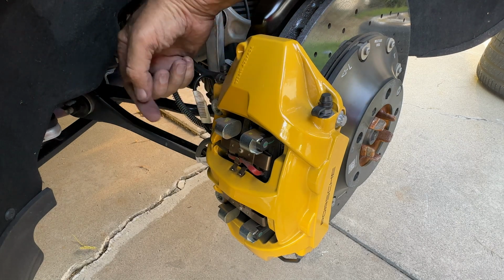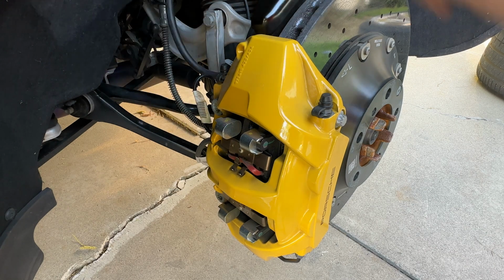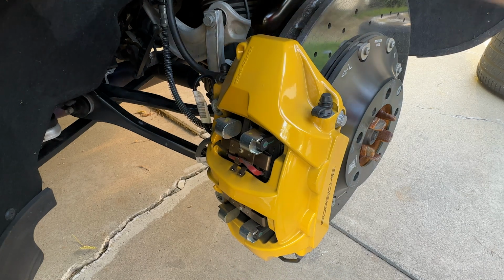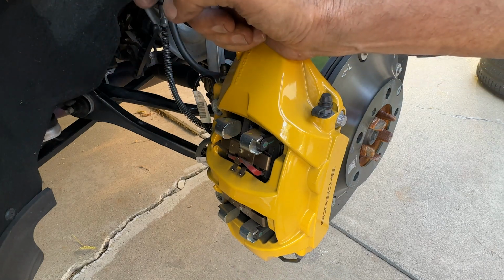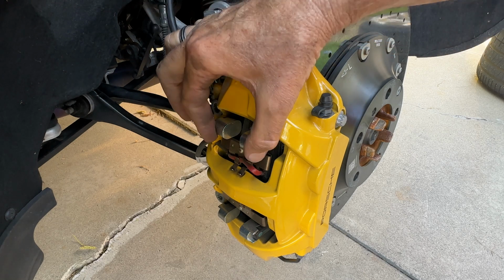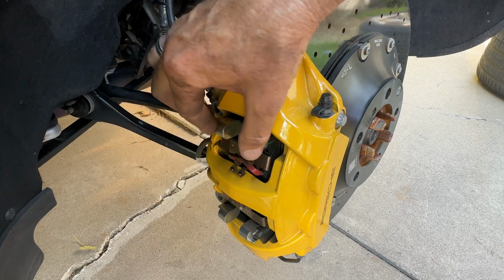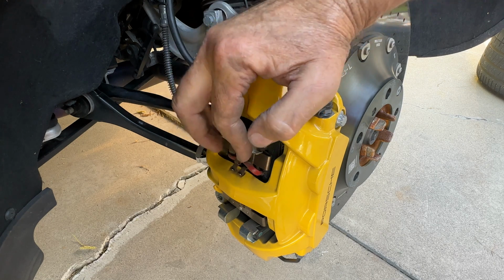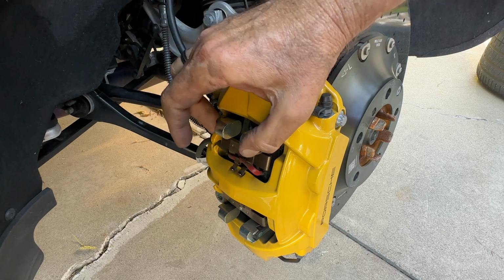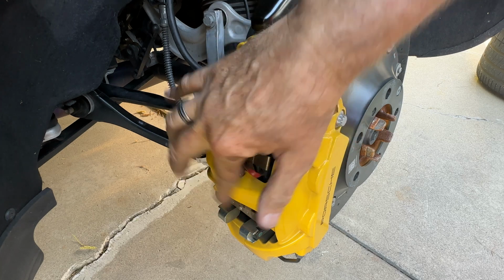So the rear caliper is a Brembo, and I know that because, well, it's stamped right down here, just out of the frame. You'll have to take my word for it. But this also has mass dampers on it to defeat brake squeal, but this is actually right on the pads. These little weights here are riveted to the ears of the pad to keep the pads from squealing. So at least we know here what structure they're trying to quiet down. It's the pads themselves. Of course, this is a little wear indicator, and of course another fixed bridge here.